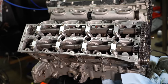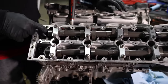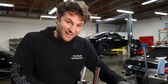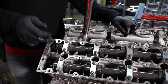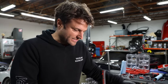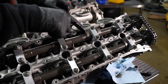Not only is the piston hidden underneath there, but the valve springs — you can see right underneath here — are $4,000 per set, at least as of 10 years ago, which means they're more expensive now. And they last only four hours. This motor costs over $1,000 an hour of idling, running, performing — per hour just in valve springs. There's a guy named Bill who documented a lot of his adventures, and he actually has a set of the two intake cams that they've ground about 10% of the lobe off. He's gotten up to 20 hours out of his motors just by decreasing the aggressiveness of the intake cam.